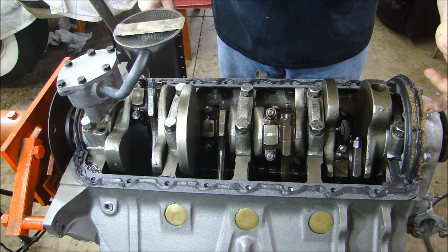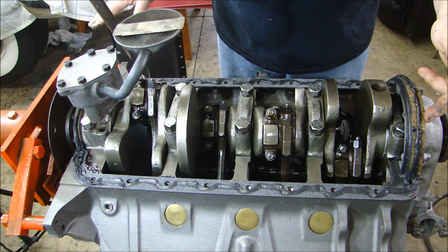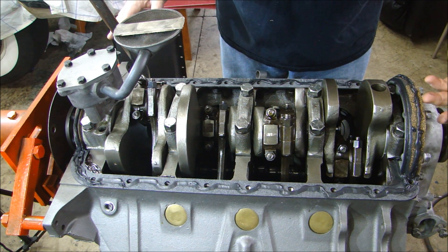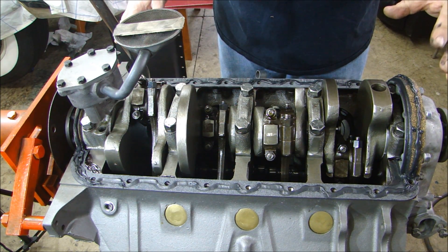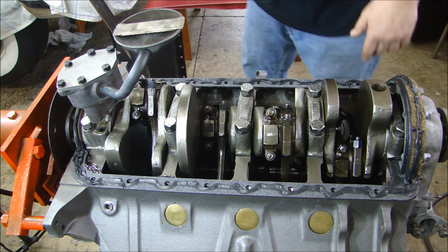When these front and rear cork gaskets come, they may be on the long side — be careful when you cut them. You don't want to cut these too short. It's better to have it a little bit long with a slight bulge in the middle, so that when you put it down it compresses the gasket. It's going to shrink, so you don't want to leave it short. Don't cut those gaskets if you don't have to; keep them as they came.